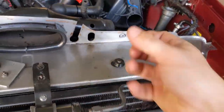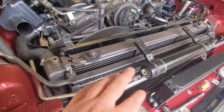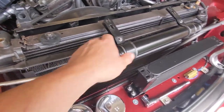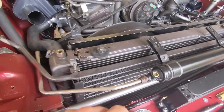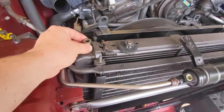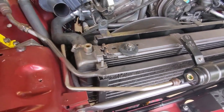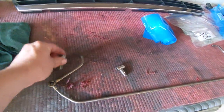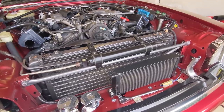I've just loosened all this air conditioning dryer off — hopefully I can just move that all out of the way because I don't really want to have to take all this off again like I did last time. I'm now just disconnecting the fan housing — there are three connections, one in the middle and one at each side, they are 10 mil. I think that's it. So in theory I should be able to just press this out of the top of the radiator and lift it all off. Yeah, that was completely off. It wasn't as simple as just lifting it off. Last time I took all this off anyway because I was refurbing — that's a new dryer and I've got new brackets here and I painted everything. But I really didn't want to take all that off again so I was kind of hoping I could work around it. I still think I'm probably going to have to take these brackets off because they're going to get in the way of the radiator anyway.